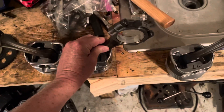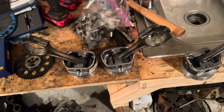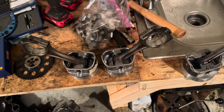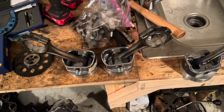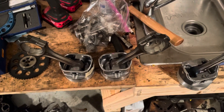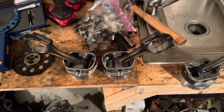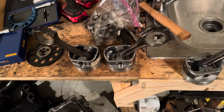So what I got was an incorrect reading. These pistons are 30 thousandths of an inch oversized, and when I measured with the micrometer I came out to four ten-thousandths less than 4.030 inches. That's a problem because the box states the minimum clearance should be one thousandth of an inch, and I was six ten-thousandths over that.